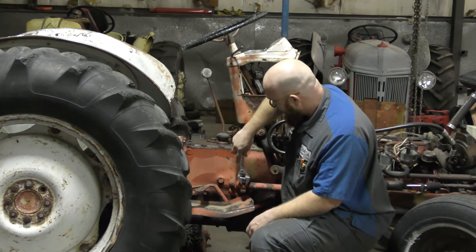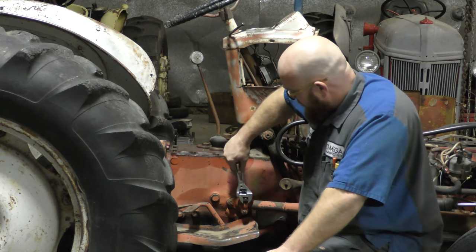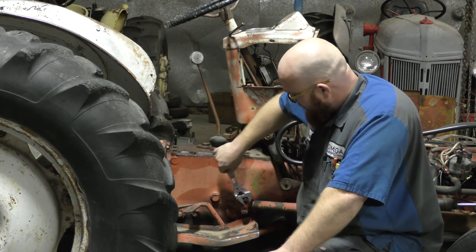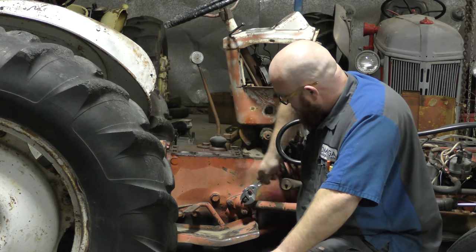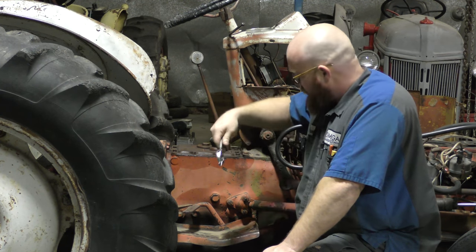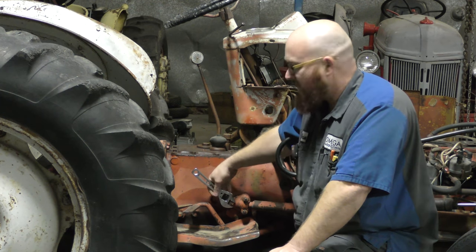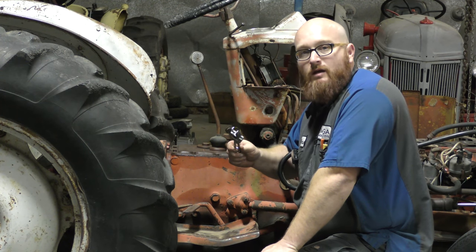So far it seems to be working. Once you get it on the nut or bolt, if you go in the direction that you want it's nice and solid, but when you go the other direction the spring-loaded adjustment just folds over like that. The thing I'm finding is that it sticks in that position almost. Could you sit under a car and just ratchet away on this thing like a normal ratchet wrench? No, I'm not seeing that. It's kind of a 50-50 shot — once these teeth expand to let you ratchet, it's a 50-50 shot if they're going to come back into position again.